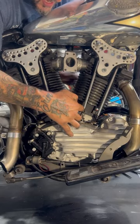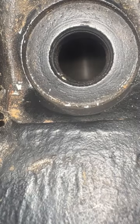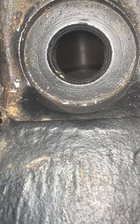Roll the engine over so your front intake valve opens and then just closes. Now you're going to roll the crank around so the front piston starts to come up and get close to reaching top dead center.